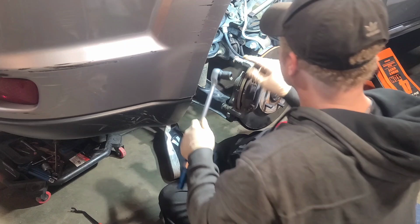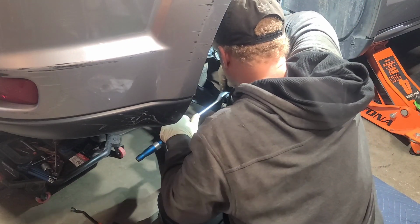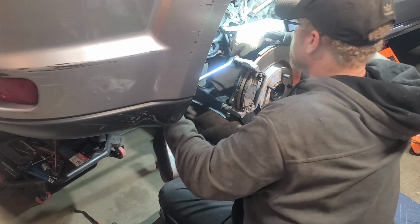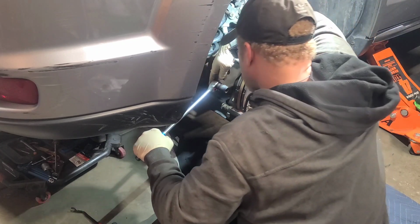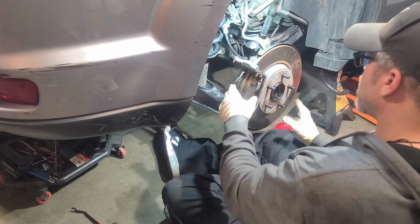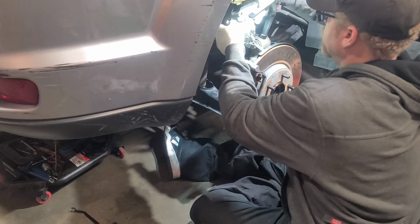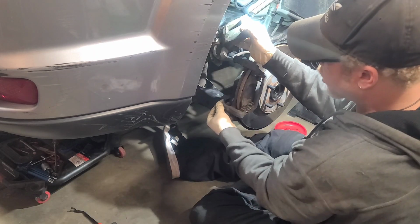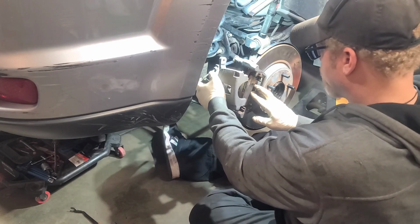And you want to tighten them evenly, so don't tighten one all the way before you do the other one. All right, so I'm about to crank. That's enough. Same thing with this one. Crank, and give it one more. That should be good enough. All right, we're great. So now from there, squeeze our pads in against the rotors. And now we can flip back the top of the caliper. Well, the actual caliper. But before you do so, check your guide pins. Make sure they move in and out freely. And we'll slide it on.